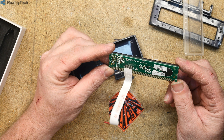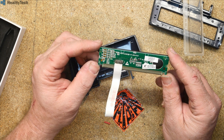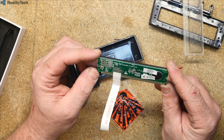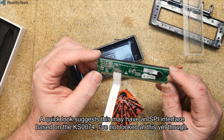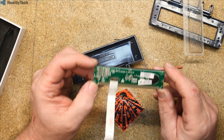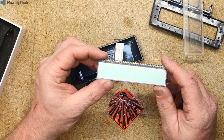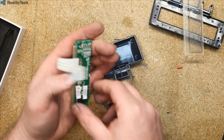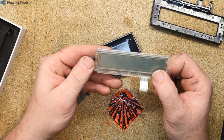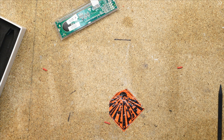There are only 11 pins there — I would still bet this is a Hitachi module. With a Hitachi module, four-bit access is possible; if you're doing this at eight-bit that only leaves you with three pins, which isn't really enough. There is a PCB number there: VLG1021, and we have a date of 2001 — or possibly 2009. Anyway, that's not really exciting, but it's a nice little display module and it is quite obviously dot matrix. A four-bit LCD like that is certainly something that could be used in a project. Unfortunately the cover is quite scarred, but it is what it is. Anyway, that was distinctly unimpressive — take care.